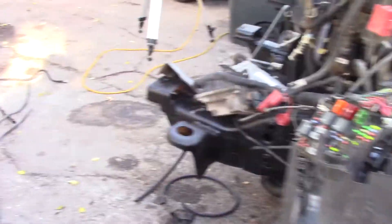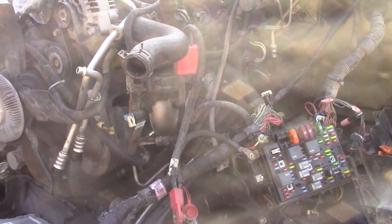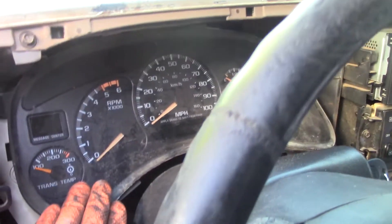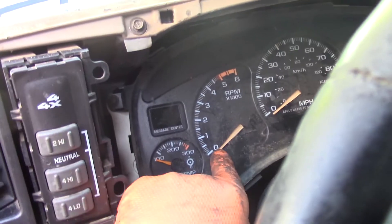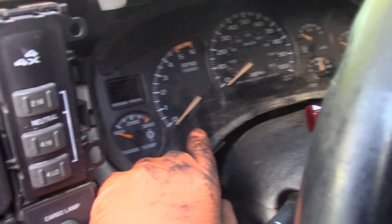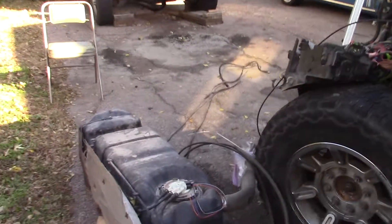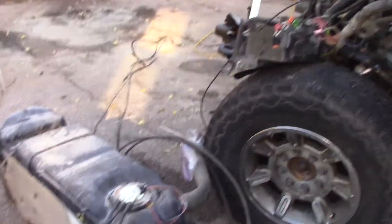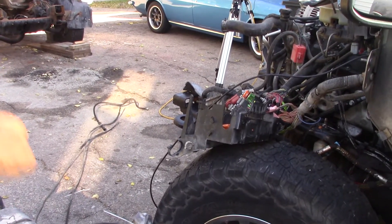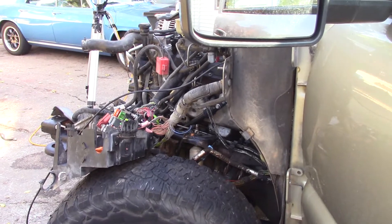The 8.1 has oil in it. I do not have a cooling system, which is fine — I just want to see if it'll fire up. I also don't have an exhaust system on it, also fine. I really just want to see if the computer will actually start it. I've also swapped the instrument panel over, which shouldn't matter much. On these GMT 800 trucks, this stuff should not be VIN-coded, but the 8.1 has a higher redline, so I wanted to have the correct tachometer and redline from the gas truck. Temporary fuel system hookup — I'm just going to hotwire the fuel pump using a little eBay pigtail harness just to get the fuel pump to fire. I mostly want to see if the computer will actually talk to the body control harness and fire the engine.